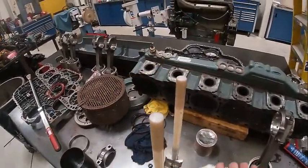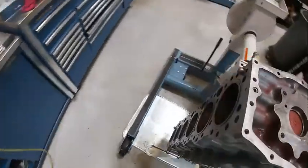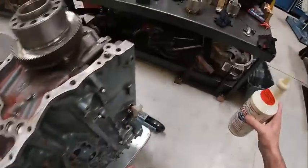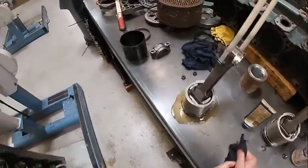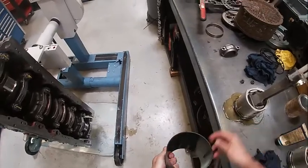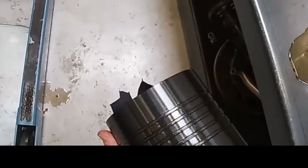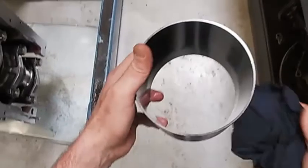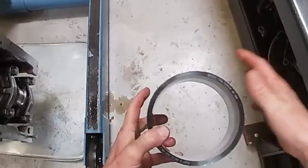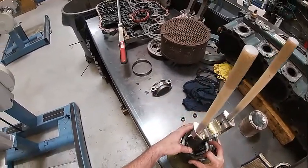We're going to lube our bearing. We're going to come in here — this is number one. We're going to lube this up really good. This is our piston ring compressor. You can see there's kind of a scratch there, so you want to check. It should be OK for this. You can see there are some scratches, but notice it's smaller on this side and larger on this side. The tapered end is going to go towards the top of the engine.